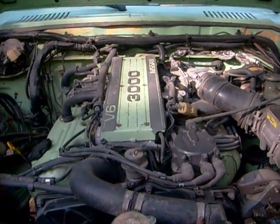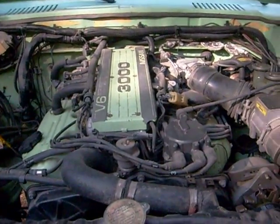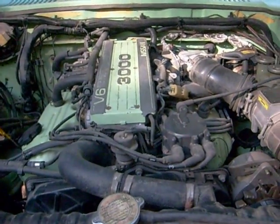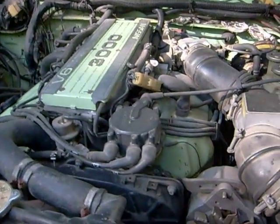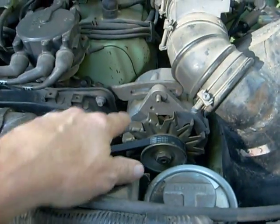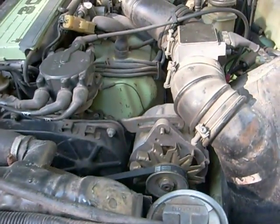The engine had about 38,000 miles on it when I got it, and the truck's got 455,000 and change on it right now, so I figure I've got at least 290,000 on this engine. It's pretty much stock except for a few items. I went ahead and made a custom alternator bracket — that's a maximum 100 amp alternator. I made a custom bracket for the bottom, flipped it up so it's up high next to the rocker cover for water crossings.